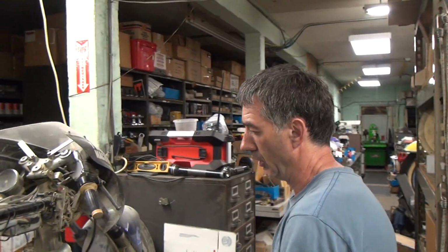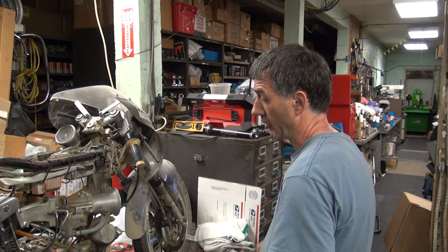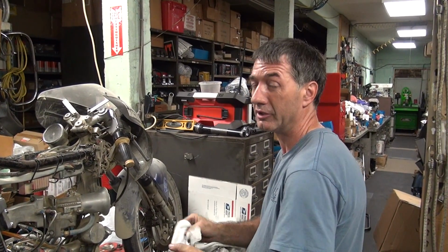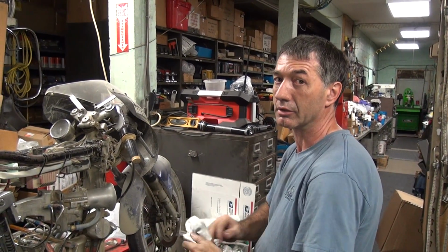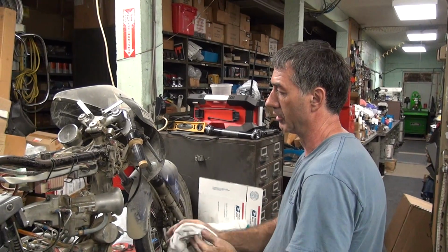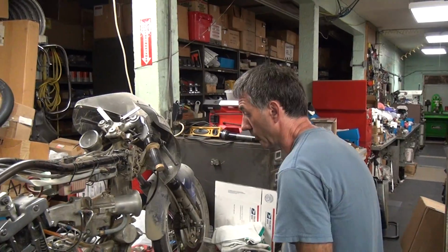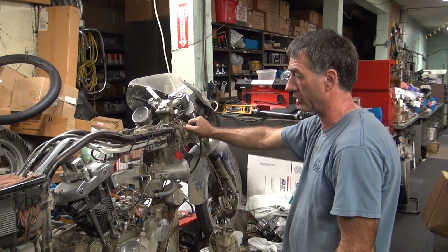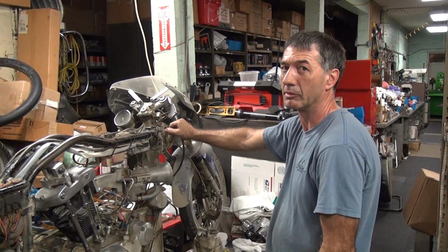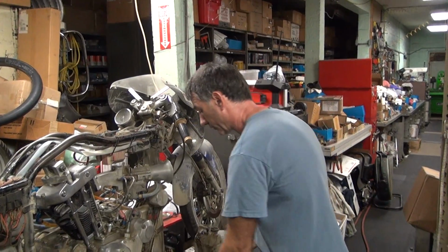So I used about 1.33 gallons, 1.25 on my first pass up there on a 1.3 mile run, so fuel economy's great. On the second pass, I only put about 1 gallon in it, so I cut down on how much I was dumping into the motor. That's better. But if I put the nitrous on it and make a pass with that, I'll probably use over 1.5 gallons of nitro on my run. It'll be pouring it in there.